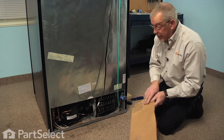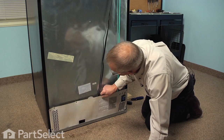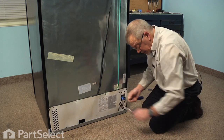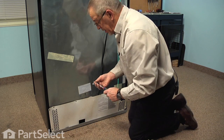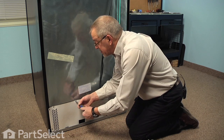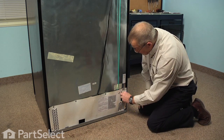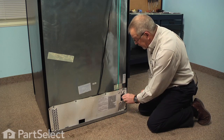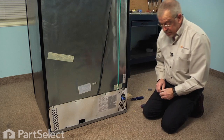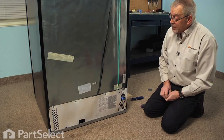Reinstall the back panel — just tuck it down into the base frame and line up the holes for the screws. It is important that the back panel is not damaged, because it is an integral part of the refrigeration process that keeps the airflow working properly. Lastly, remove the protective cover on the inlet to the fill valve, then reconnect the hose water supply and tighten that securely, and turn that water on — make sure that we have no leaks. Once completed, push the refrigerator back into position and reconnect the power. I told you it was an easy job. Thanks for watching, and good luck with your repair.